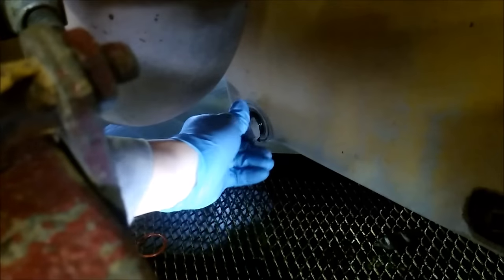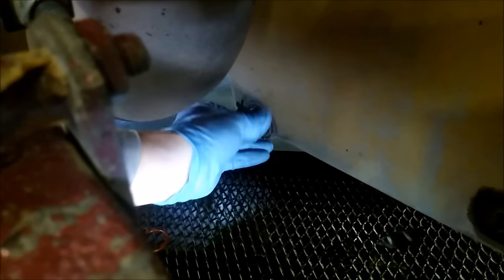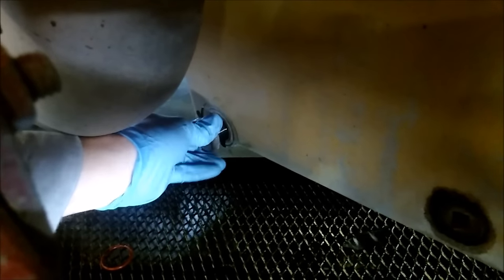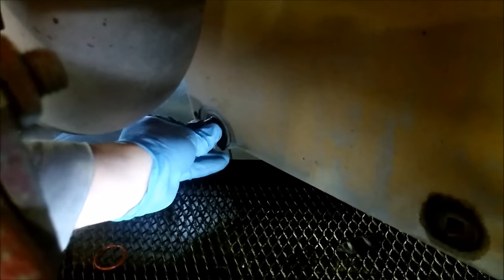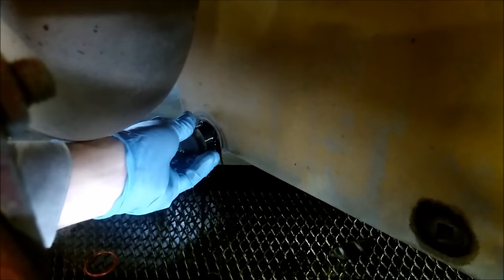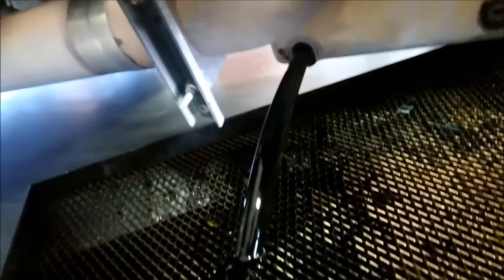It's not going to damage it. I just try to loosen it and then take the plug out by hand. Now you always want to be careful with this, because you should always do an oil change when the oil is hot to make sure all the contaminants have stayed in the oil. If you do it when it's cold, you're not going to drain as many contaminants out of the oil. So do the oil change with the engine as hot as possible — yes, it's harder and it's obviously hotter, but it really helps get a clean oil change.